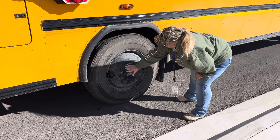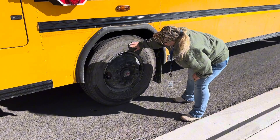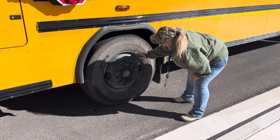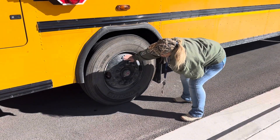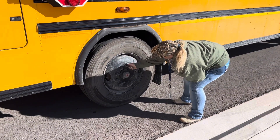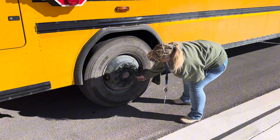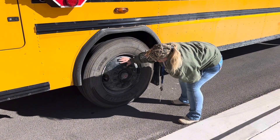The condition of our tire: we have no bulges, no cracks, no chunks missing. It is securely seated on our rim. We're looking at our rim — there are no illegal welds and there are no cracks or dents. We're going to be looking at our lug nuts, making sure they are all securely attached. There is no rust trailing, which would indicate a loose lug nut.